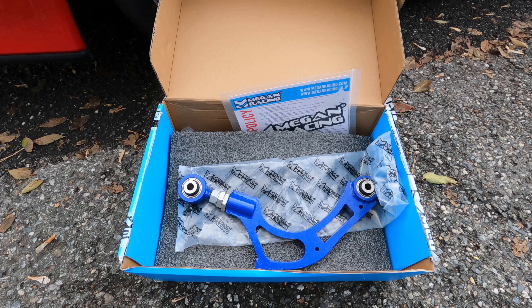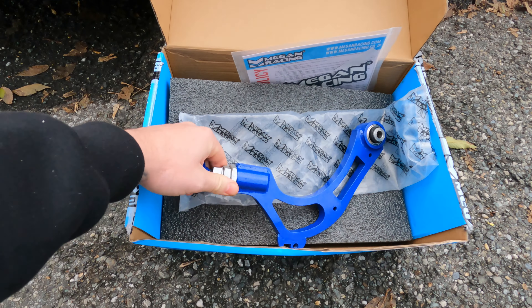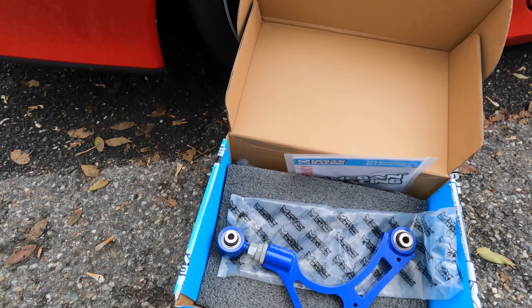When I drive, I'm probably running about negative three degrees of camber, so I was getting really bad cupping in my tires. I knew this brand from multiple cars and never had an issue. The only issue I ever had was the adjustment threads rusting in winter — where I live it snows. I learned to take it apart and anti-seize it, and it works really well.